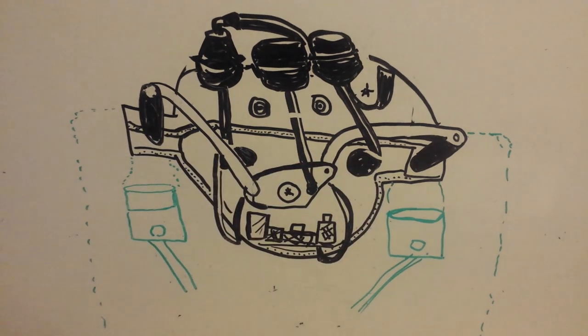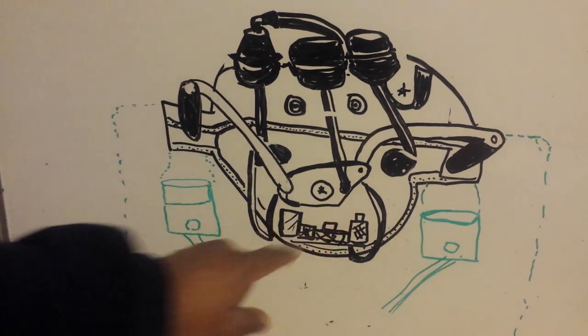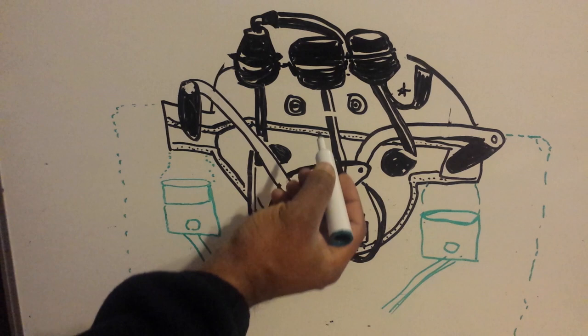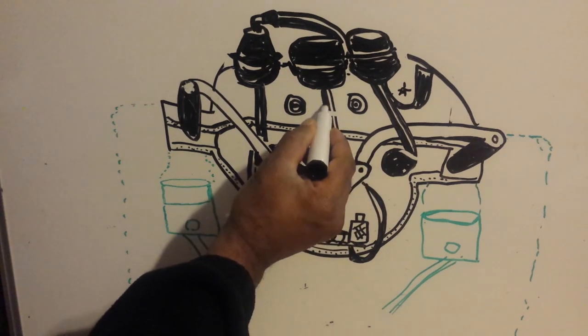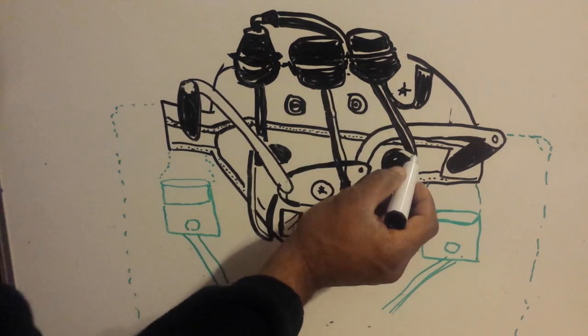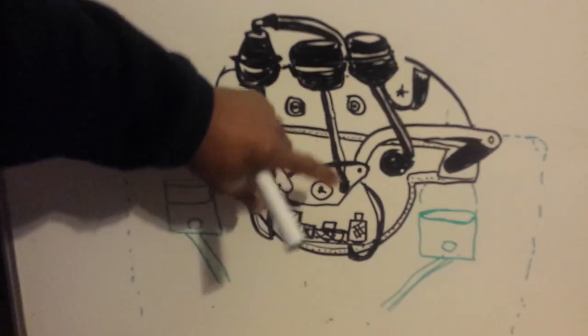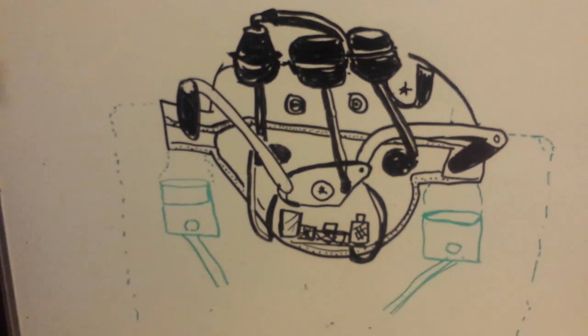and once it breaks, the flaps on the inside of the manifold are stuck in that position. So on an air intake manifold that's working, when it receives vacuum, these actuators will create a vacuum and close. Let me put it back. These actuators will cause this pivot to either open or close the valve.